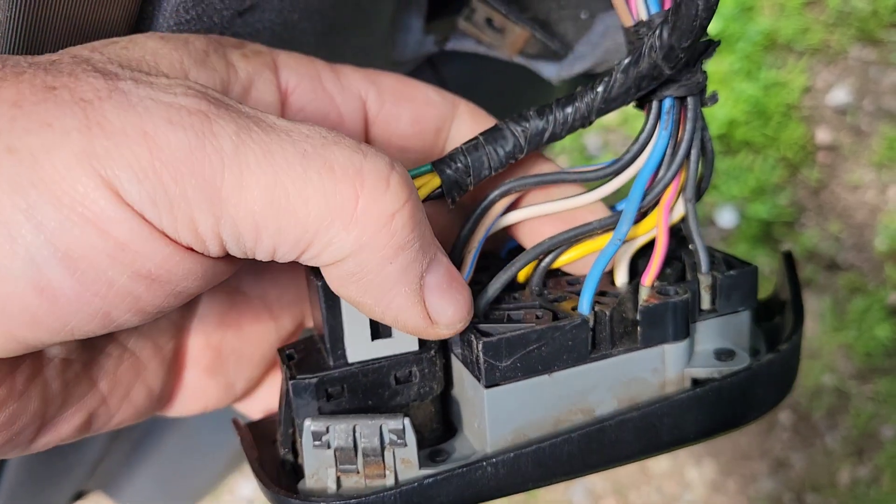I'm trying to figure out what makes sense here — why both sides don't work. What I keep coming to is that they have a shared ground, but neither up nor down work. So either it's this light blue/black... I'm actually leaning toward the light blue/black because that's a common power. The ground down there looks fine. Common blue and black here — those are the colors that do actually work.